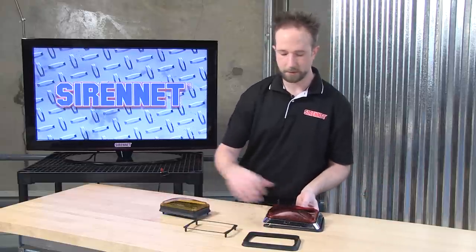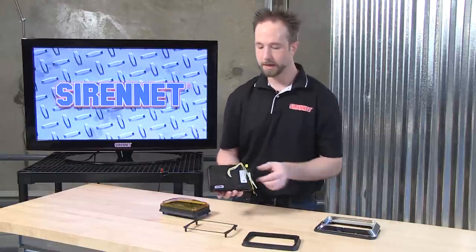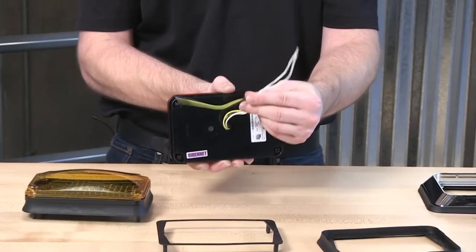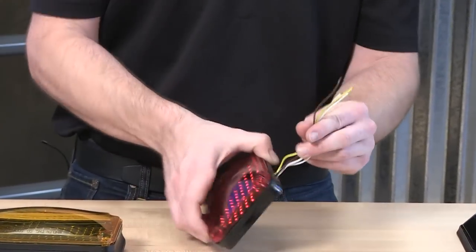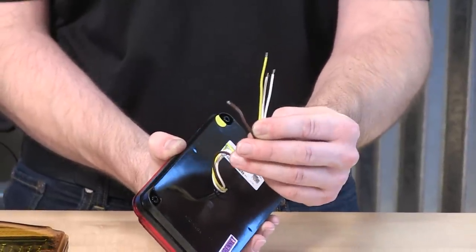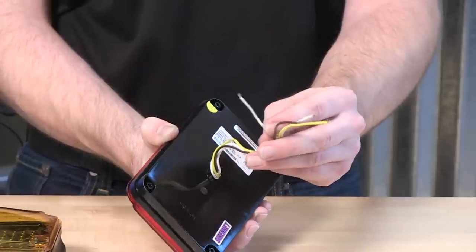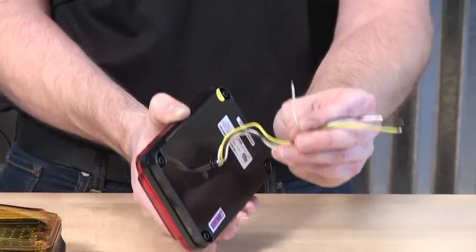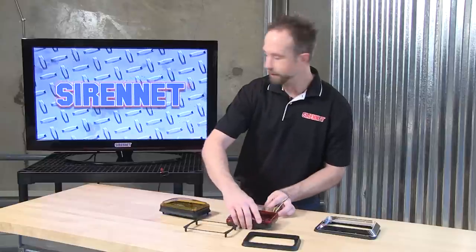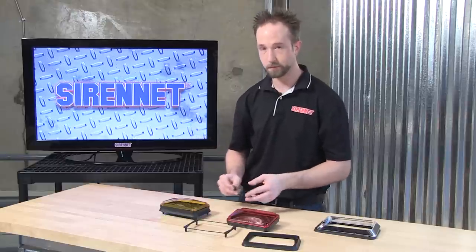Now that I've shown you a bit of the insides and the flange — chrome and black available — I'm going to give you a look at how the light heads work in regard to the pigtail on the back. The 600 series brake tail turn has four trigger wires. It's a little different than typical light heads from Whelen Engineering. You have a white, a yellow, a brown, and then the classic white with violet tracing, which is the ScanLock. There's not a black trigger wire for the ground circuit — in this case, the ground is actually the white trigger wire. I'm going to set the 12-volt clips and put power to this light head so you can see how it'll work.